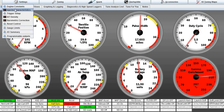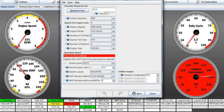The next thing we have to do is the same thing for number two. To do number two, I need another timing mark. Using the geometry I just looked at, we're pretty sure it's 450. That means we need a mark 90 degrees away from the other timing mark on one side or the other. So you'll have to figure it out, spin the engine around, and then go another 90 degrees in your mind. Get a timing mark there, then do the same thing: put the timing light on number two, make sure you have the spark settings right up in TunerStudio, and then crank it and observe it. If it's left or right, start adjusting this number.